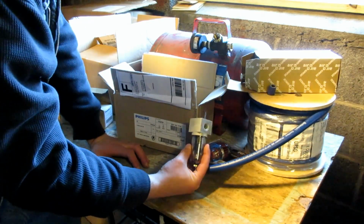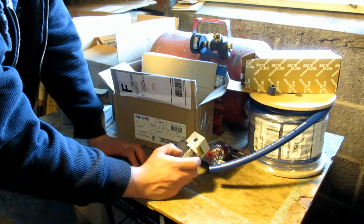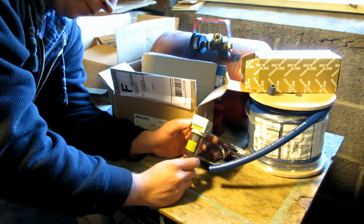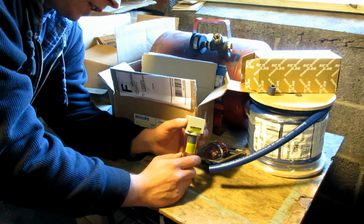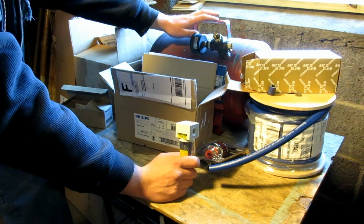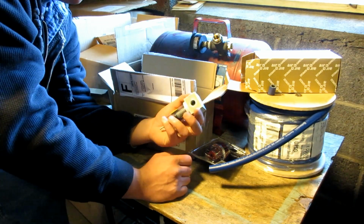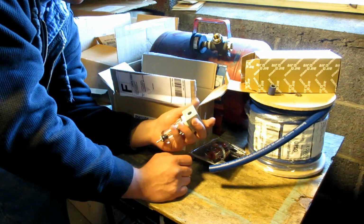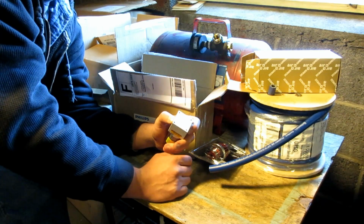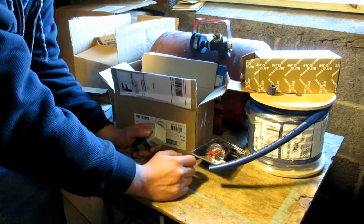This is then a filter to remove the oil that I just used to put into the AC compressor. This is for after the AC compressor though, because I thought about it and I could have just let the oil permeate through the entire system, but I decided I didn't want to have all that buildup inside of my tank of oil and stuff, so I went and found a decent coalescing filter that will remove any of the oil that comes out the outtake side or output side of the AC compressor before it goes into the rest of the system.